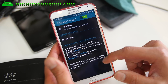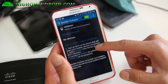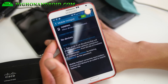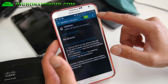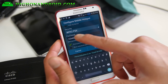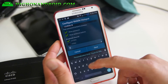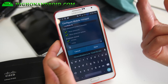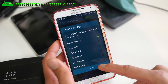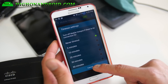Go ahead and turn on your hotspot. Make sure you choose an AP name that's easy to remember — I named mine 'Note 2' because we're going to enter it into the repeater. I usually switch between my Note 2 and Note 3, so I just name it Note 2, and you can name any of your phones that way so this will repeat the same signals. Also set a password so no one else can connect. Set the password to something like 12345678, use WPA2 PSK. Go to advanced options and use 2.4 gigahertz. For channel, I set it to 6 — something you can remember. Also for timeout settings, make sure you have it set to never timeout so the hotspot is always on.